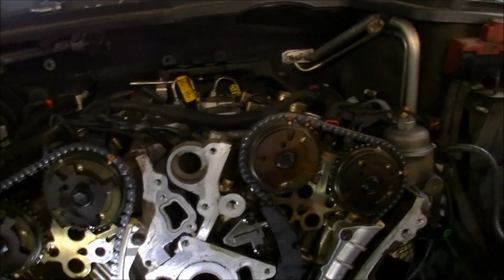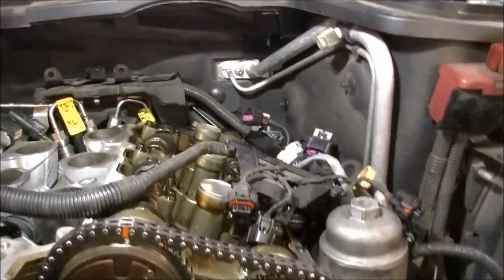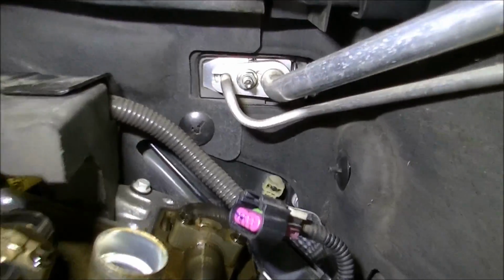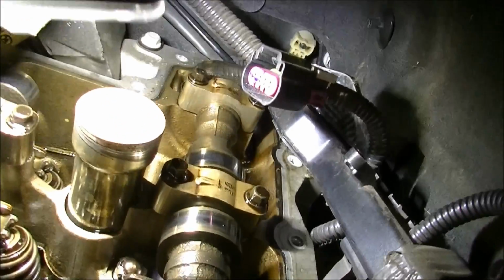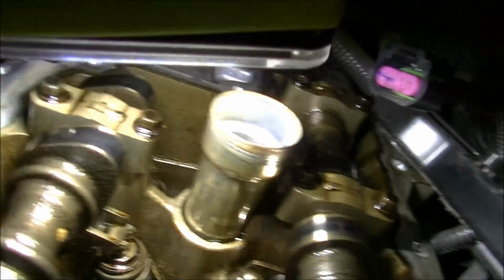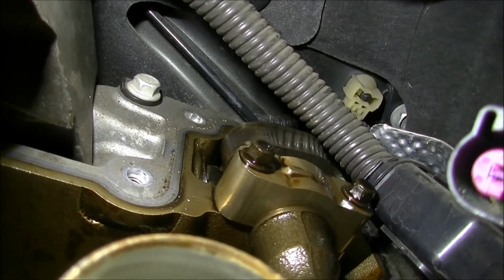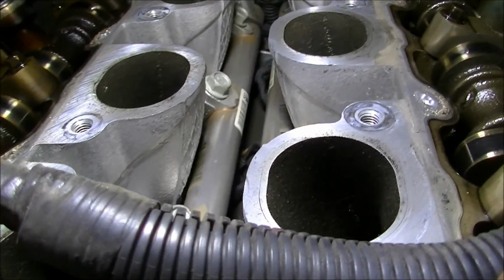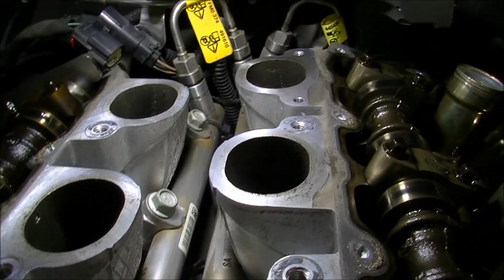Now listen, I'll tell you something else. This is why these things are a little different to the normal Alloytecs up the back here. I don't know if you can see. The cam would normally finish, you know, with the end of that one there. This one goes on further up, right up into there. That's because it has a fuel pump up there for the direct injection. It runs about 3,000 psi into that rail there, as I believe.